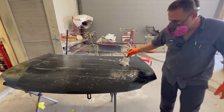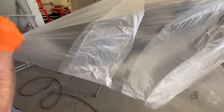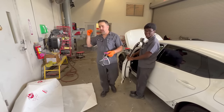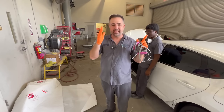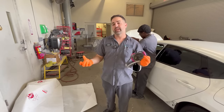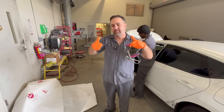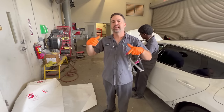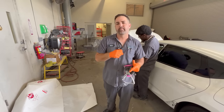One quart was enough to get the right thickness. What you want to do is trap it by covering it with plastic. Now you can see we just covered it - it's very strong guys, so make sure you do this in a well-ventilated area. Also don't do this outside in direct sun, because if the sun is beating on it, it's going to dry up the aircraft remover too quickly. You want this stuff to stay open so it can penetrate. That's why we put the plastic on - to keep the fumes down into the hood. We're going to give it a good 25 minutes - don't try to poke at it early. Give it thorough time. I'm going to go have some lunch and I guarantee when I come back, I'll be able to scrape off the majority of that paint right off.